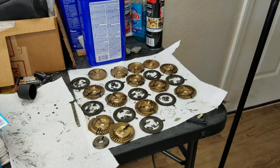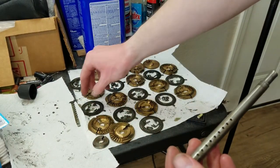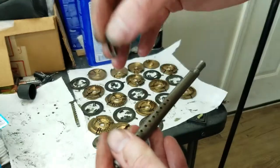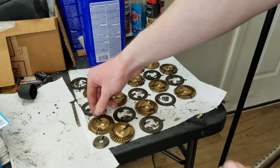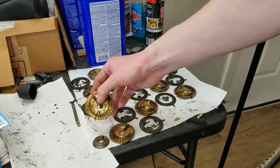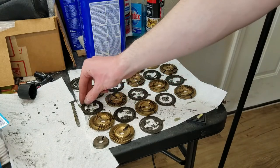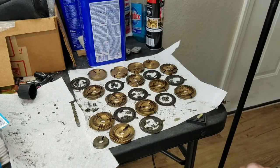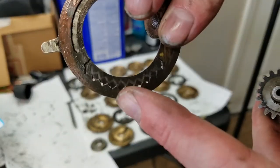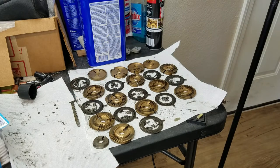And I kind of have a feeling you're not really supposed to take it apart, because it turns out you can see these holes here actually take springs, and then those springs push on, you can see there's a corresponding hole, maybe. In there, the springs push on those, and then those ride up and down, and these little slots here, like that, and those are the detents. You can see the cutout there, that pointy end goes in these cutouts here and is the detent for the pinwheel cylinder.